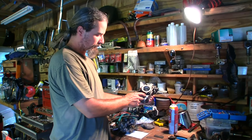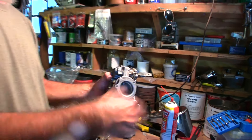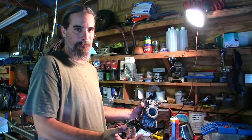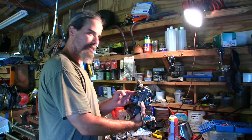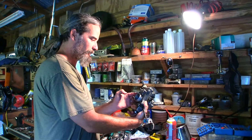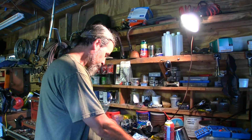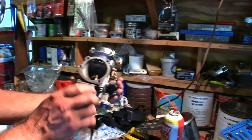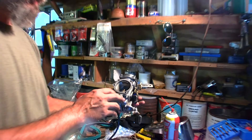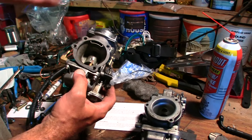Here it is — this is what I just pulled off the motorcycle. It is a Mikuni carburetor. This thing is the reason why when I test rode it in the parking lot it burned the wheel, which is exciting I guess, but 30 miles to the gallon — I don't think so. This is what a lot of people use primarily for racing and on the drag strip. Now, this is the CV carburetor — meaning constant velocity — that I'm going to put on there. This style of carburetor came out in 1988 or '89 and was used all the way up until 2006 on all Harley-Davidsons, all Sportsters and big twins.